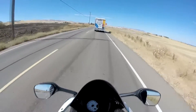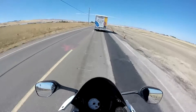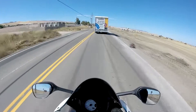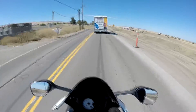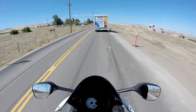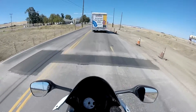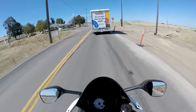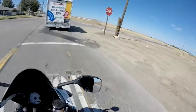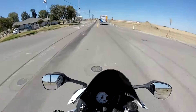As we just trudge along behind this goddamn U-Haul truck. So as I said in my first video about the problems my bike was having — basically when it's something electrical, it narrows it down to three things: the battery, the stator, or the regulator rectifier. Something you want to do if you're having electrical problems on a GSXR 600 or 750 is just assume it's the rectifier.